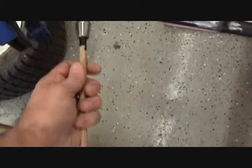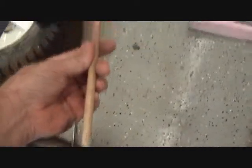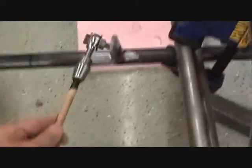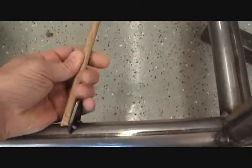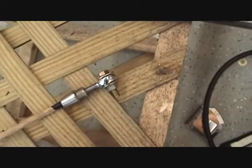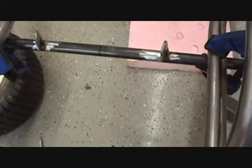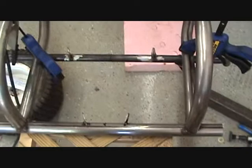This is what the heim joint is going to look like. It will bolt into that and then tie to the front frame member. We'll have four of these heim joints on each end to allow the suspension to flex up and down. Now I'm going to go ahead and fab up some of these heim joints and actually bolt it to the front axle and move the axle up and down to make sure nothing's binding.